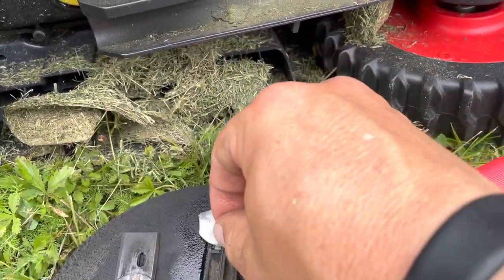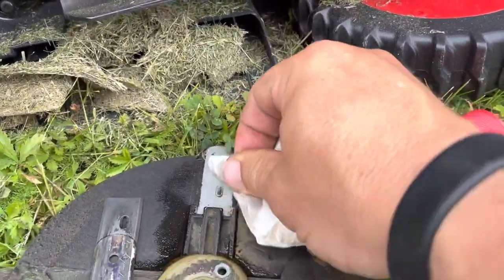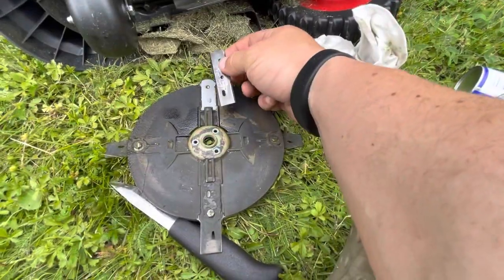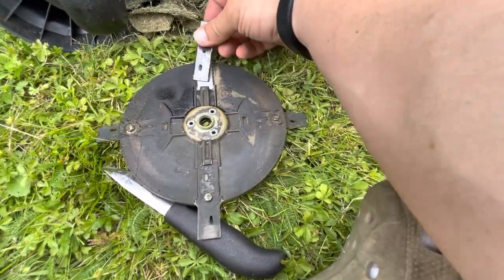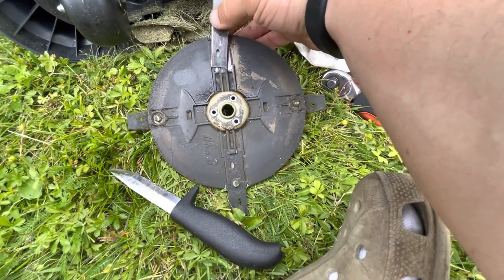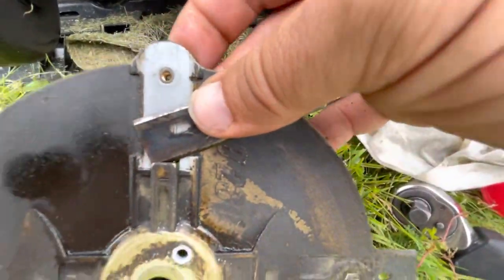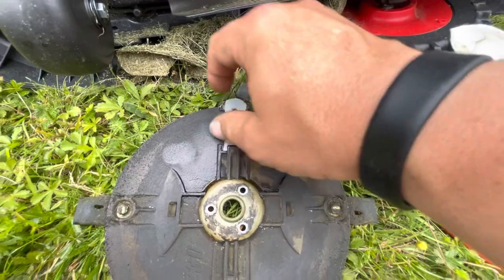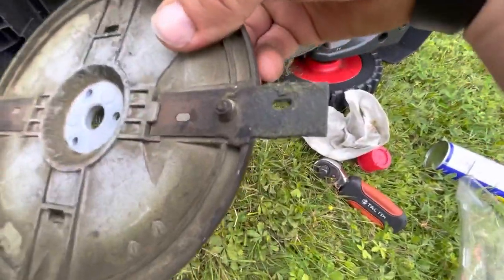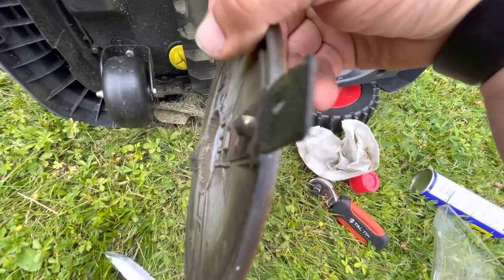It's not very hard, but I think it's necessary if you want the robotic lawnmower to survive a couple of years. There's a little difference between the two different blades: the ones exposed towards the lawn are screwed into a hole with threading in there. The blades hidden behind the plate on top have a little nut you have to keep track of.